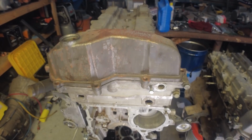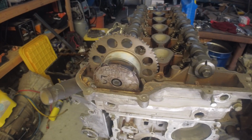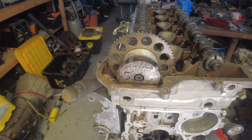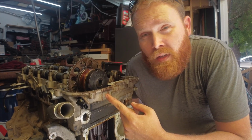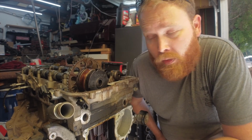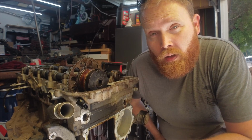They are identical in almost every way except for the cam sensor being present in the 2007 and down motors, and the 08 and newer motors only had the exhaust side cam sensor, just one. The other modification you need to make is inside the valve cover. The 2004 to 2007 exhaust cam reluctor had two different part numbers for the different head designs, but they were all 5X reluctors. The 2008 to 12 had a 4X exhaust cam reluctor and a 1X intake cam reluctor. There was only one part number for that era of motors.